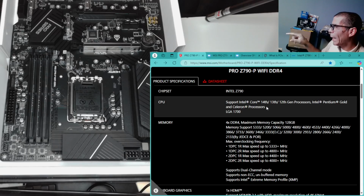What you have to match is the generation number. So you're going to have the i3 family, and the i7, the i5, the i9, etc. That is the processing capabilities of the chip. Then you have the different generations, which are kind of like features that have been added. It's like a versioning thing.